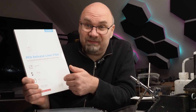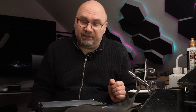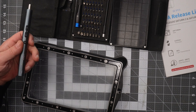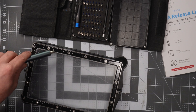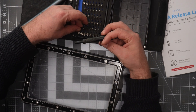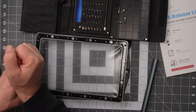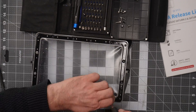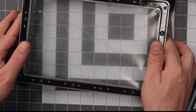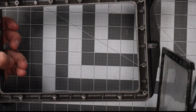It says this PFA film is for the Saturn 2 and 3, but I think it will work with the 4 as well — I know this will work. The electric screwdriver is not strong enough to loosen the screws, so I will start manually using my iFixit screwdriver to loosen all the screws, then move the bit to the electric screwdriver to take them out. Now we can pop out the frame.